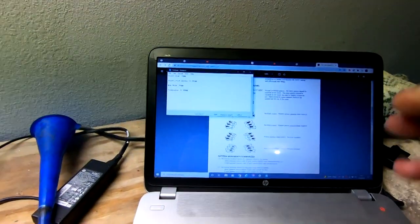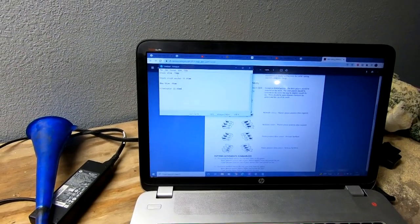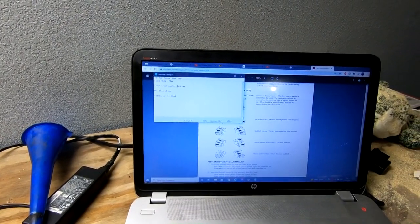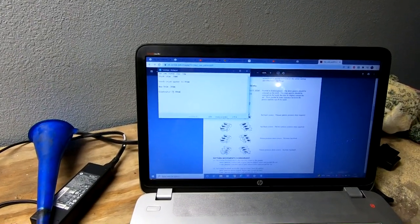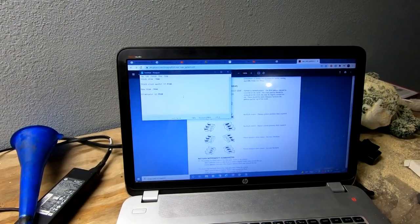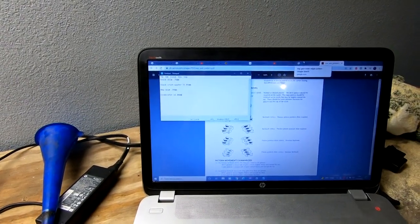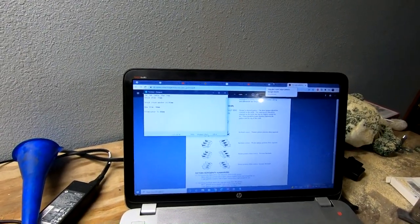All right, so went ahead and measured everything. So our stock shim was 0.74 millimeters, and the new one's 0.94 millimeters. We'll see how that works out. And then our stock crush washer was crushed down to 11.01 millimeters. The closest I get the Eliminator kit was 11.08 millimeters. So considering that it felt a little bit light on the resistance that was on there, that should be just fine. So let's go ahead and put it back together. I'm gonna do that off camera, and I'll meet back up with you when we get our next ring pattern and see how it looks.